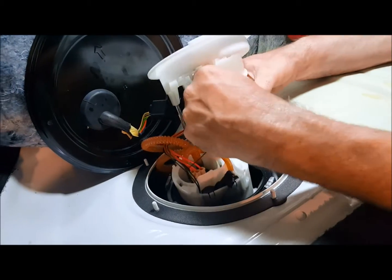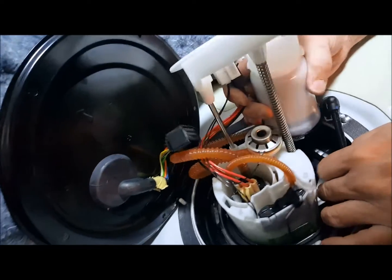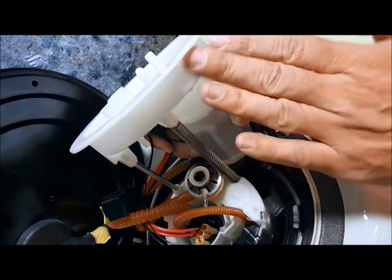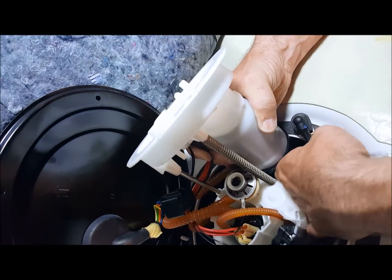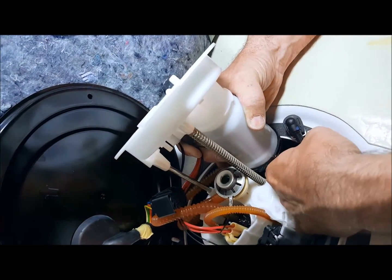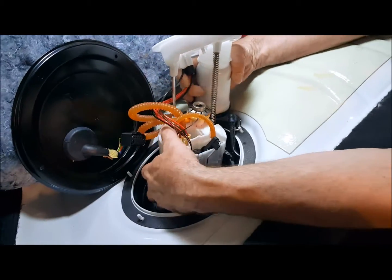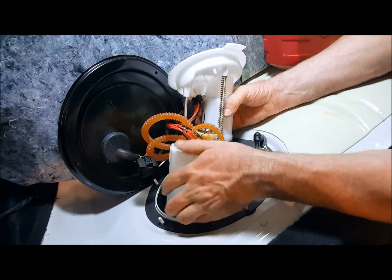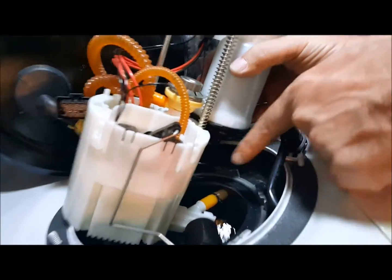Get those up and out of the way. Now that we've got those up out of the way, it's really hard to see in here, but if you can just barely see down in here, there's the fuel line that comes across right here. We need to take and rotate that 90 degrees so that it is pointing towards the trunk of the car. You can see what I mean as I pull it up and get a little better view. Go ahead and pull the whole pump assembly up, tilt it, and just let it sit there and drain a little bit of fuel out.